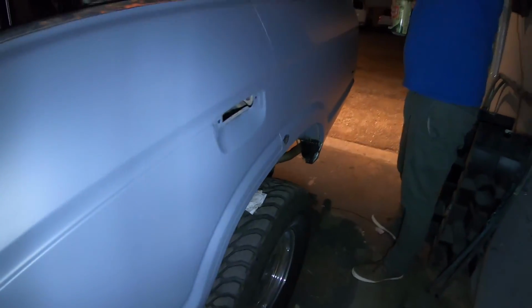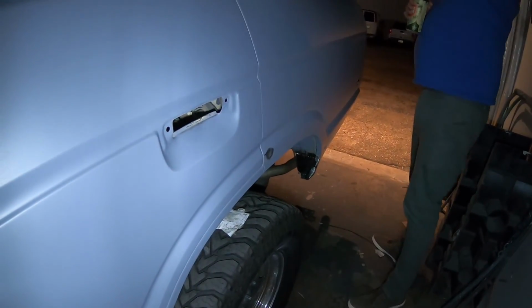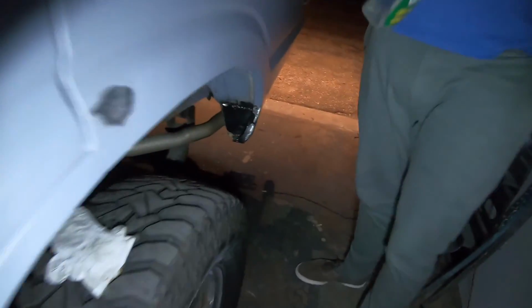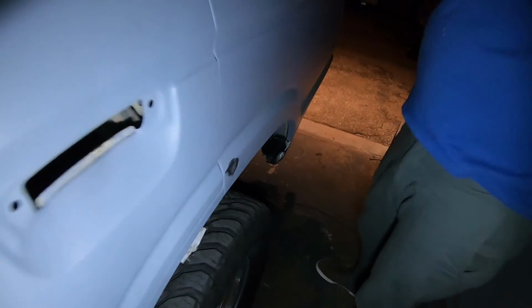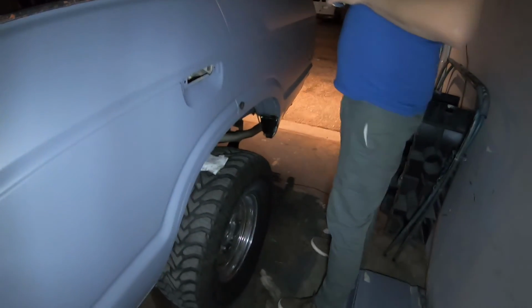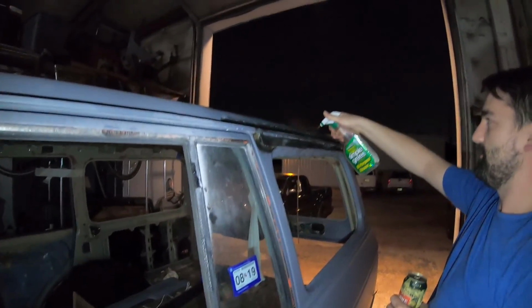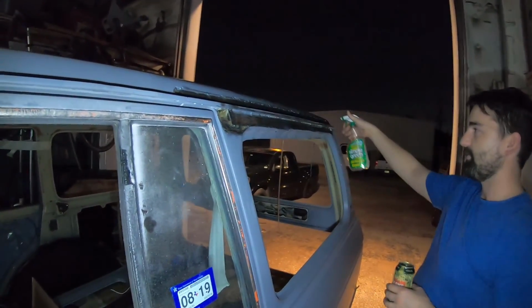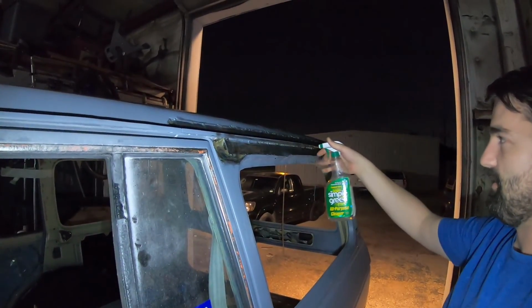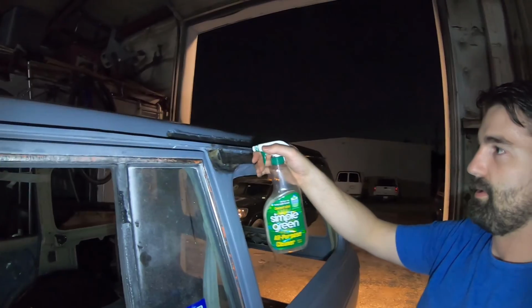Oh, we still need some, what is it, high fill or filler? What's that stuff called again? The parts that I didn't completely weld, like there's some gaps. Seam sealer. So after the POR-15, we'll do seam sealer. Yeah, because you want the most rust resistant coating first, which is POR-15 in this case, and then the seam sealer will go on over that.